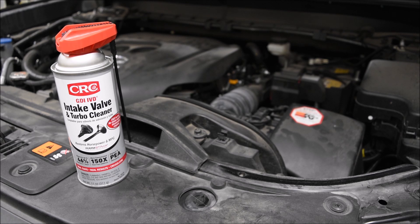I did not have this issue on this one. I have done this before on another car and while driving it, it went into fail-safe mode. That's when several of your dash lights come on and you've lost a lot of power. That happens when the computer picks up that something isn't right — I'm sure it's the carbon deposits breaking up, coming through the combustion and out the exhaust, probably enough to set that off.